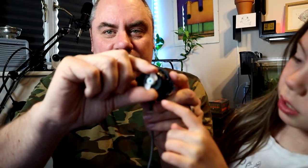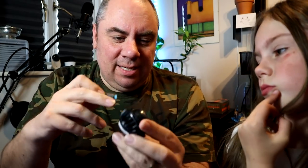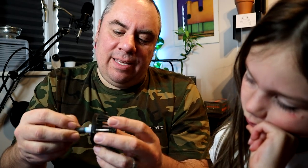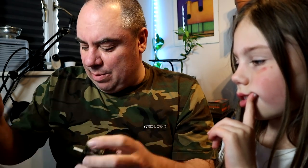And this bit just pulls out simply like this. And you've got — that's your impeller. So that's the blade that spins around. And this is a magnet. And the motor's in here. You can't easily get into this bit, so you're kind of stuck with it. But generally what happens is it's this bit here — dirt or algae, or whatever it might be, will get in there and stop it spinning freely. So if it doesn't spin freely, or even if it does, it's still worth giving it a good clean.